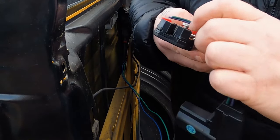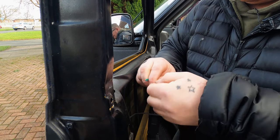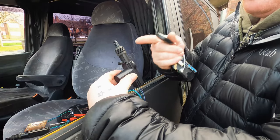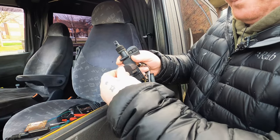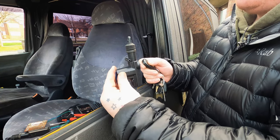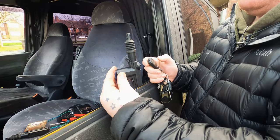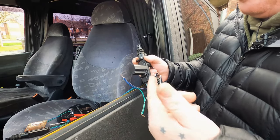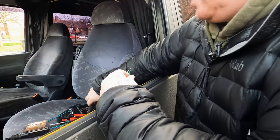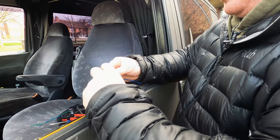So we've got the new actuator. We'll bare the cables off and put them both back together, and we're going to see if the actual central locking works. Make sure the wires don't touch each other. We're just going to press the key fob and see if this works — it might be the cable further down in the loom. We have movement! And so that's locked now — open, and locked, open, and locked. So it was either the brittle cables further down the line, or it was the actual actuator itself. Let's just undo these and we can test the old one, just to see if we need to replace the actual thing.